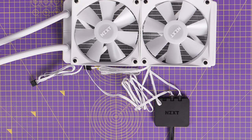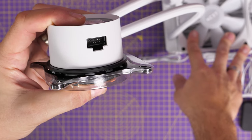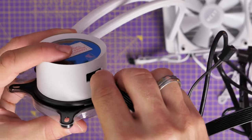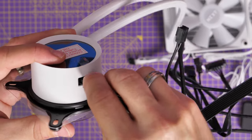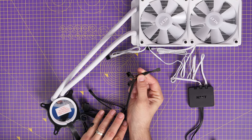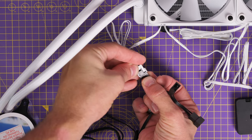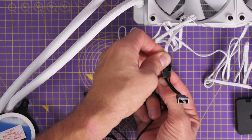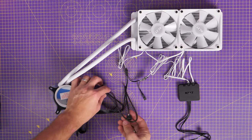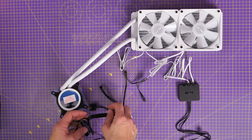The pump head itself has a large connector on it, and this is an additional breakout cable with lots of different connections — it's important to push it in until it clips into place. Out of this cable comes one cable split into three parts which gives you the fan power. You'll use two of those connectors for the two fans; there's a spare because the design is the same as a 360mm cooler with three fans, so no need to panic. There's also a USB cable and SATA power coming out of the pump head — the SATA power goes to the PSU and ensures the pump gets the power it needs.